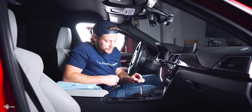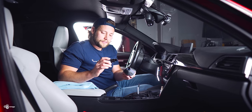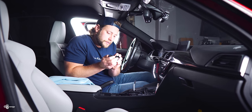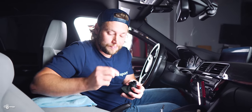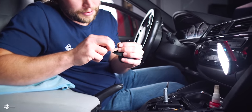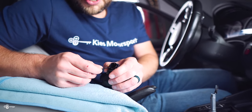Before we get started with the installation, I do want to mention that we've put a little piece of electrical tape over our connection just so it's not going to rattle around. With that, we're going to take our new gear selector and put it in here. We're going to pull the shift boot up so we can start to see these threads. It comes with three microscopic little set screws, and that's what's going to hold everything in place. We're going to take each one, put a little bit of blue Loctite on there, and partially thread them in.